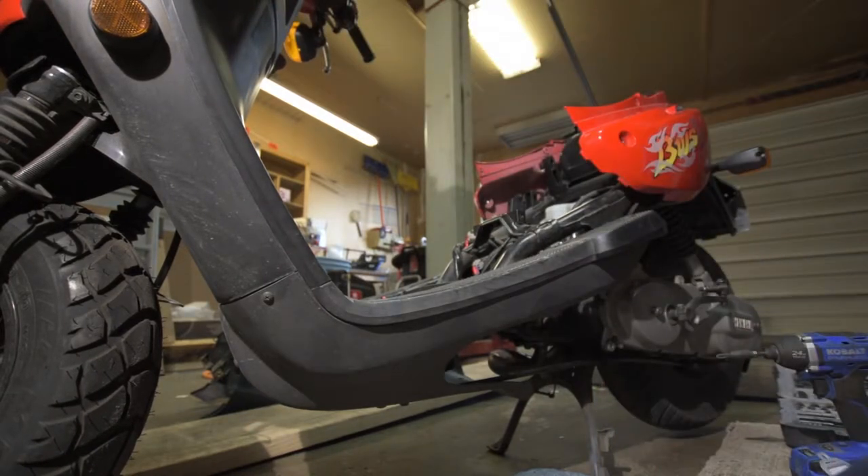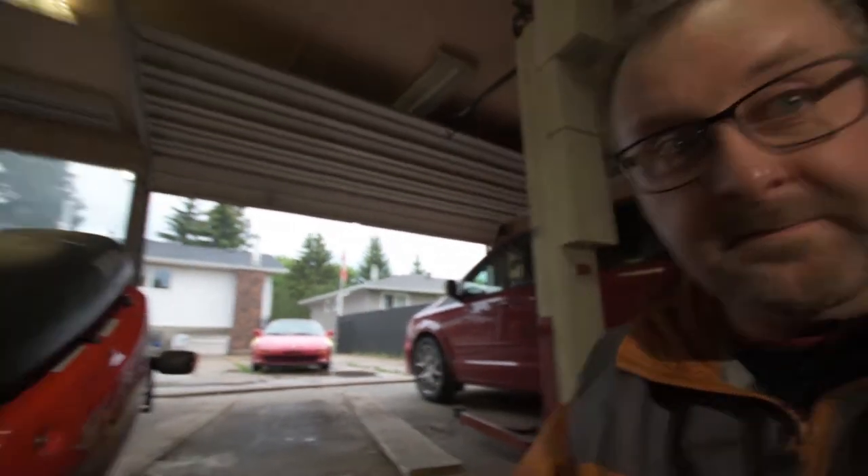Well, she starts and she runs, so this is all good. I'm going to button it back up and take it for a rip. Okay, so that was an epic failure — that was too much fuel, fell flat on its face, did nothing. So I'm going to try, just for fun, the Polini 78 jet, because I don't know what that 80 means — maybe it's the same. The 78 jet was very similar to the 80; I didn't notice any real change. So I'm going to leave it in there.